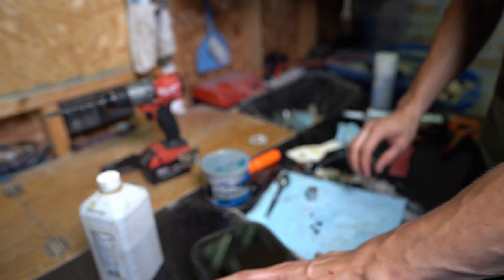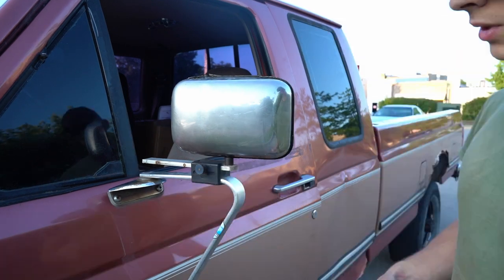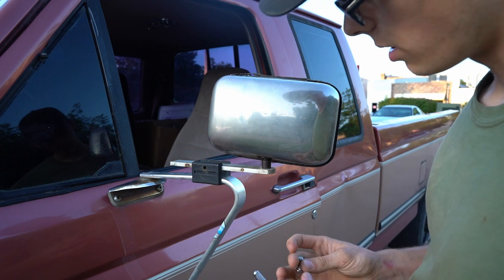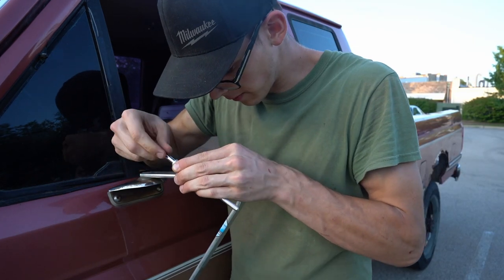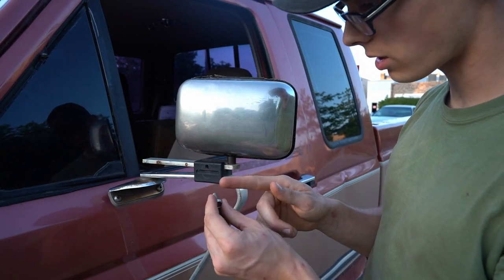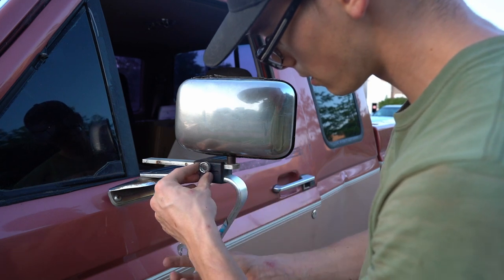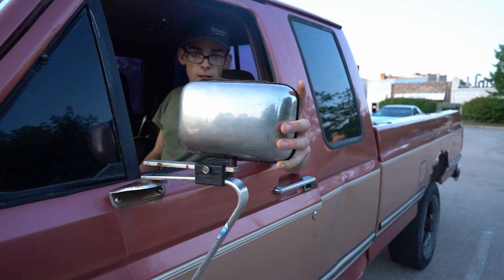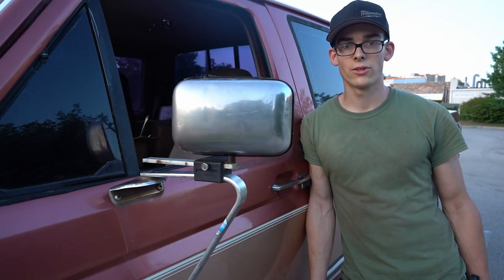Now I'll go ahead and put it on the truck. Out by the truck, I'll put this in here, tighten it down, and tighten it down with a pair of vice grips. The bolt that was in there was a quarter-twenty and it stripped the threads right out. So what I'm going to do is put in a five-sixteenths bolt. Now I'll put this back and put in my new bolt — this is a little bit too long, so I'm going to cut part of it off. Now that I cut it down, I'll thread it in here and carefully tighten it. Now that's locked in. I just need to adjust the positioning of the mirror — perfect. So now it's all set.